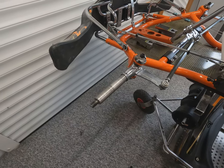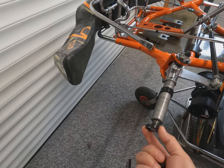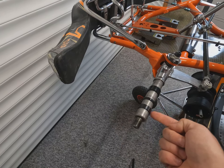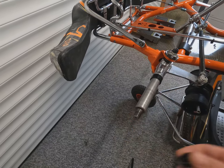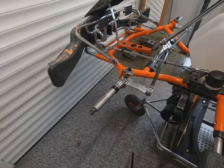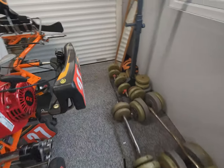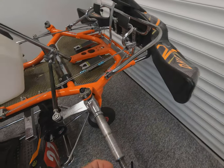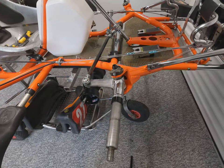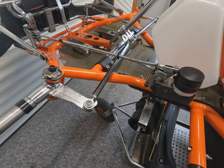On the front we're going to go for a 15mm spacer. Spacers come in a variety of 5, 10, or 15mm. We're going with just one 15mm spacer. We won't fit the hubs just yet because we still need to do the caster, camber, and tracking on the front end, but we'll fit the spacers on both sides now so we don't forget. Same as at the rear — if you take 5mm off one side you've got to take 5mm off the other side, so you're affecting total track width by 10mm.